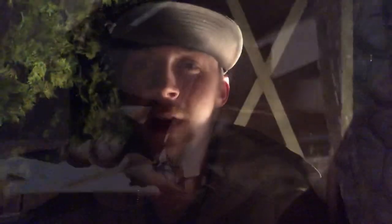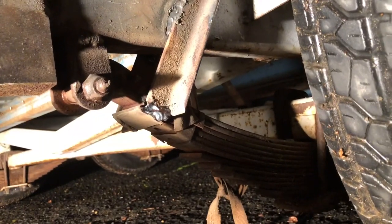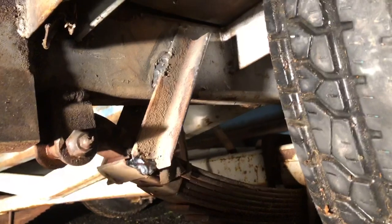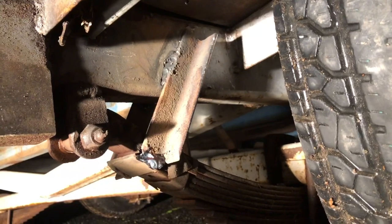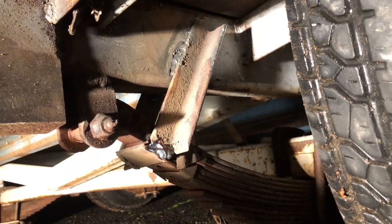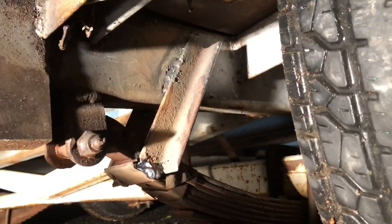After that I need to do a little bit of wiring to get the lights going, then throw the fender back on this side and I should be good to go. Here is my MacGyver of a bracket — it looks horrible but it's going to work. It just hangs from the frame at the same angle as the leaf spring, keeping it somewhat in place. Leaf springs are tempered steel so you can't really weld to them, and that's why this thing broke in the first place — someone decided to weld it together. It should be fine for a two hour drive with an 8,000 pound truck on it.